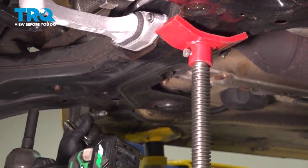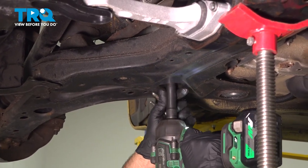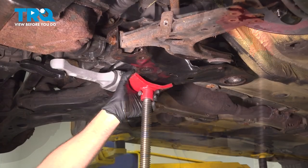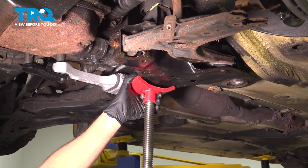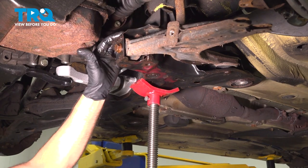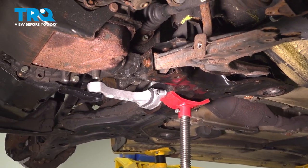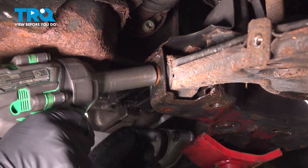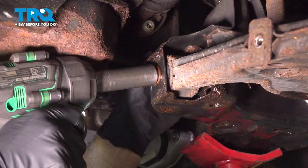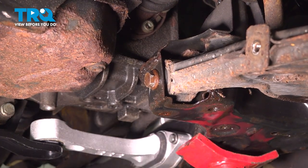And there's two over here as well. Now we can lower this down; the steering rack should stay. Then you should be able to access that bolt using an 18-millimeter socket — take this bolt out. Tip it down a little more.